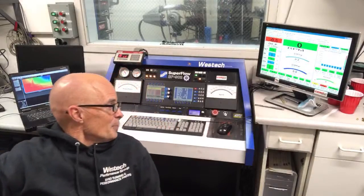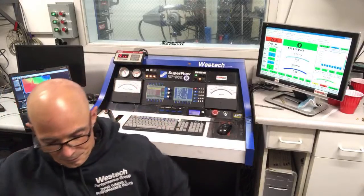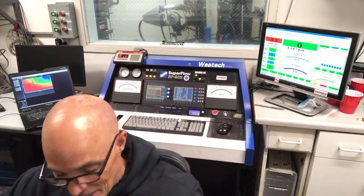You want to see the GT45 at 30 pounds. At 30 pounds, it would make a lot of power. So if it's 20 horsepower per pound, that's like 600 horsepower on top of the, it won't do that. It won't do 600 horsepower on top of the NA power. The GT45 I don't think is good enough for that.